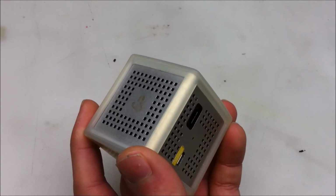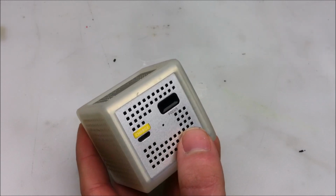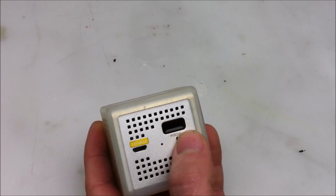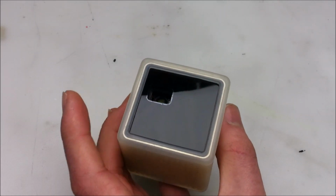The one thing I don't like about its construction is that the internal battery has some exposed areas, and normally on a lithium ion cell like that, the outside of the case is positive, and it comes in pretty close contact with the aluminum frame here, which as you've seen is also part of the grounding circuit on the main board on the inside.